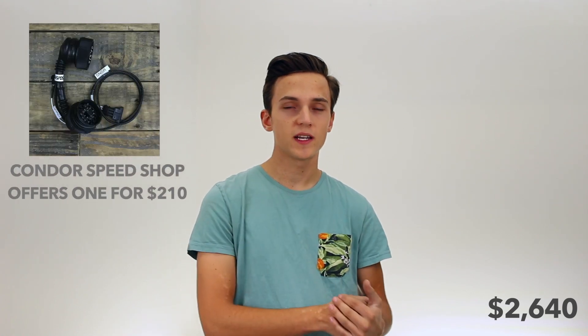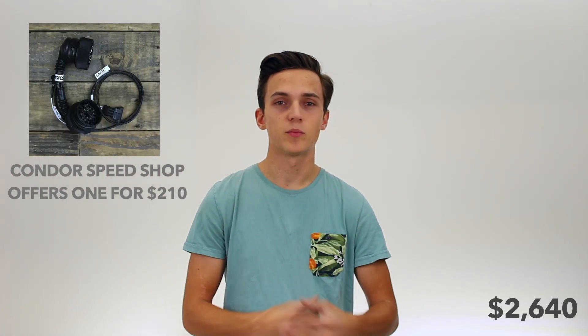You're going to need a Red Label 413 ECU to run this engine. Ideally one came with the engine that we bought, but if not, you can buy one used for around $50. You'll also need to adapt the E36 engine harness to the E30 body harness through the C101 plug. Garagistic used to sell an adapter plug for about $200, but it's no longer on their website, so you'll just need to pin it yourself — which is free, but costs a lot of your time.